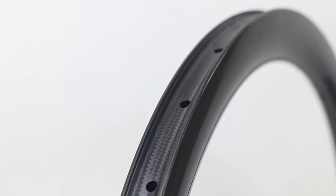You'll notice that the Falcon Pro rims are only available in a hooked bead. While a lot of manufacturers have been touting the benefits of a hookless bead for everything, we've found that tire manufacturing is too inconsistent to properly seat road tires on a hookless bead at high pressures. For that reason, we chose the hooked bead, knowing that it'll work for you no matter what pressure you choose to run.